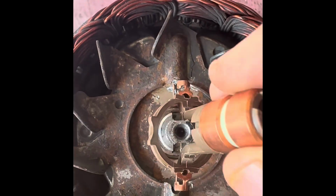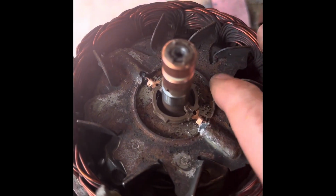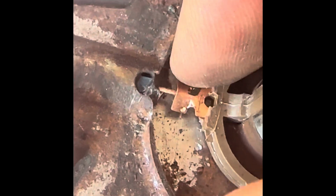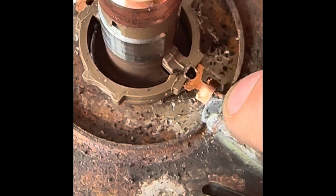So I'll put this on here now, and I'm just going to gently tap that down. Okay, that's down there. I just put a screwdriver handle on there and then just tapped it with a soft mallet. So you can see that's over there perfectly. So I can just nip that together and tighten that up. And I can just do the same again with a pair of pliers there and nip that up. And then what we can do is put some Araldite in.